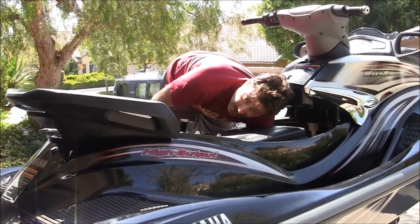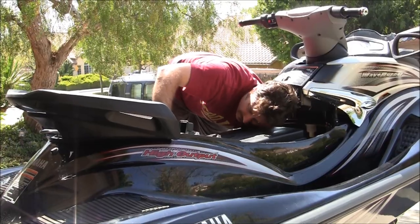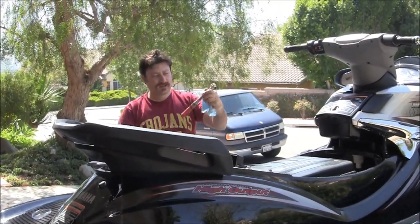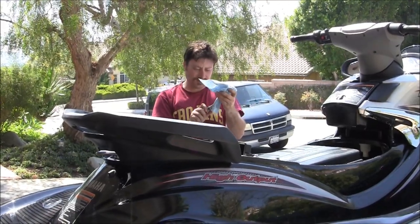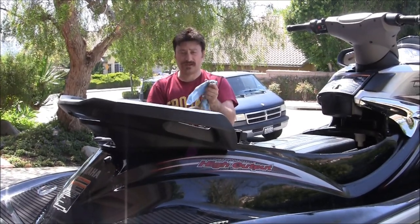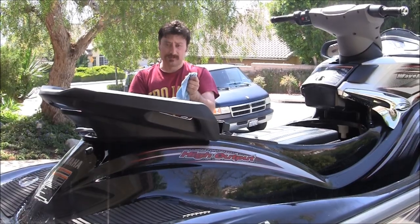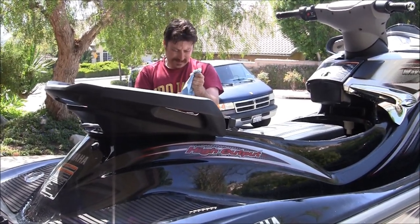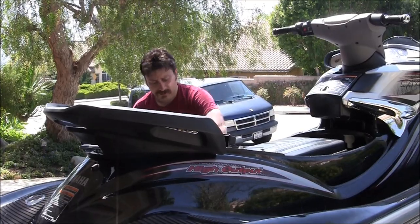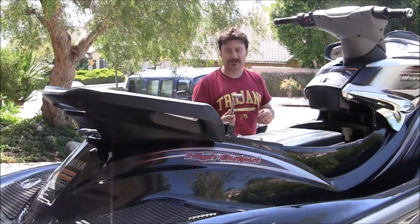If you don't have a torque wrench, this is not rocket science. Just go hand-tight as much as you can, and maybe a quarter turn at the most with your number 17 socket. Here's my torque wrench — Utica. We're going 17 newton-meters. You really don't need a torque wrench for an oil filter — I would definitely recommend it for more important stuff. Just don't over-tighten your oil filter because it will be a nightmare to open it. It will click the moment it hits the torque. And I would not use the torque wrench to undo the filter — use just a regular socket wrench.